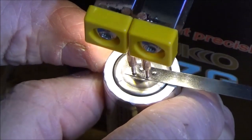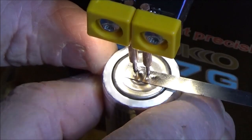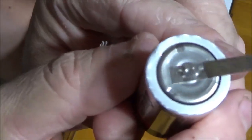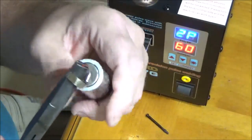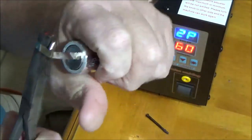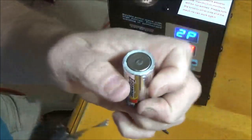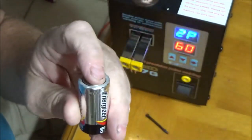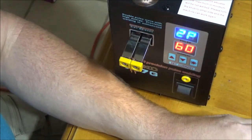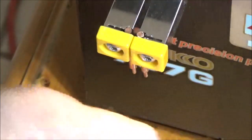Just lay the strip across the battery and give it a quick weld — give it a couple of welds. It makes for a good solid weld. I'm going to do a pull test on this and see what gives way. As you can tell, the welds pulled off but it was super hard. So let's up the amperage and try it again to see if we can get some better penetration.